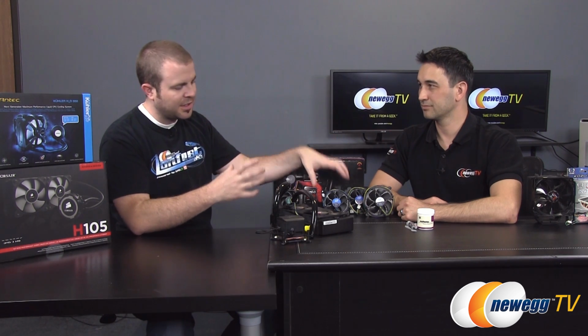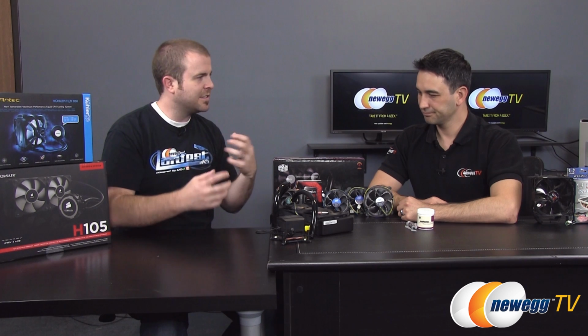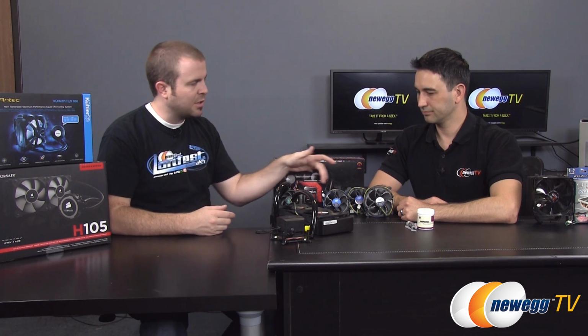But if you do that and you find out that you have say an old stock heatsink fan that's probably got some stuff up in the gears or something, and it's having to spin more, or it's gotten really caked on with dust and everything on the top, that's really a great option to say, you know what, I want to take that out, get something like the Hyper 212 Evo. There's a lot of reasonably priced aftermarket coolers in the $20 to $40 or $50 range that can give you a really nice boost in performance, give you more overclocking headroom.